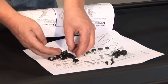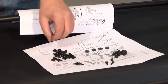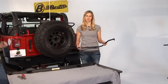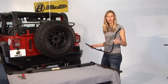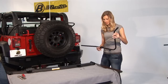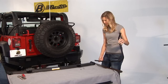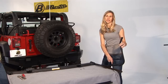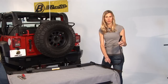For the hardware you'll need the 8 by half-inch pan head screws with washers already attached. To install the front bow into the header assembly, the pivot knuckle needs to face in and the tab needs to be toward the outside. This tab will point down when on your vehicle — but since we're installing the header upside down right now, it's currently facing up.